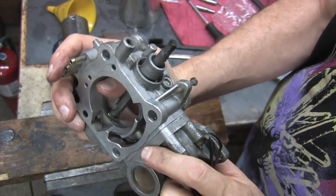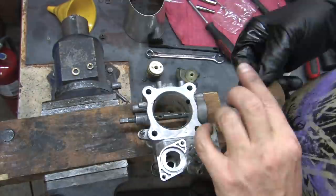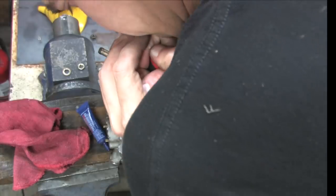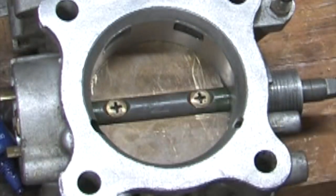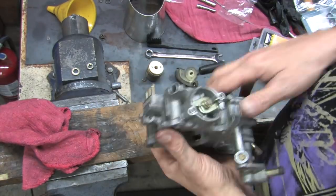There, now a throttle plate and everything else that's supposed to go into it. This is that moment where all the OCD people rejoice. The screw heads lined up perfectly. How do you like them apples? It's good to put the throttle plate in as soon as you can because it keeps the throttle shaft from slipping back out from the lip of the seal.